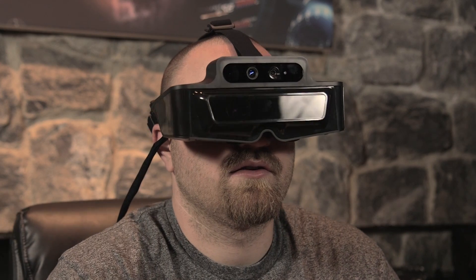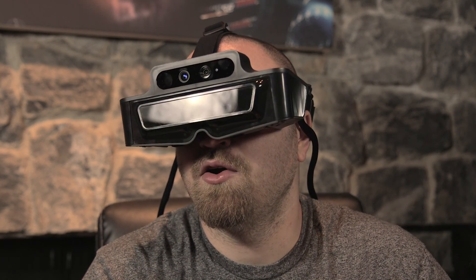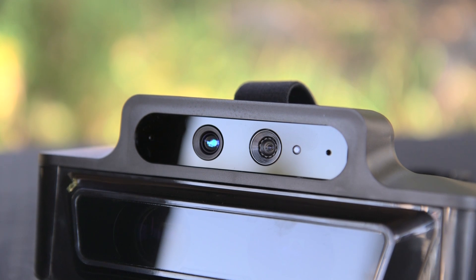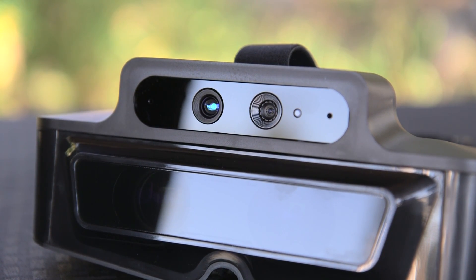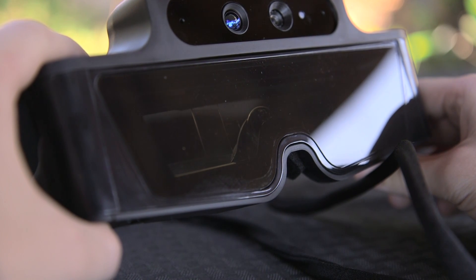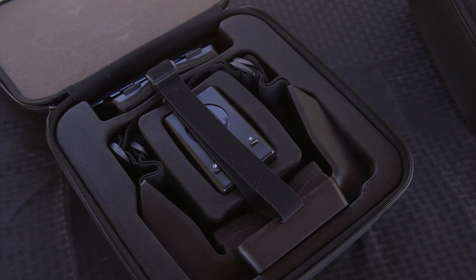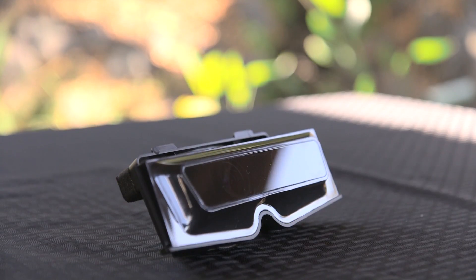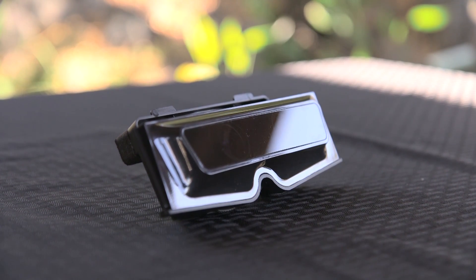The current developer kit is definitely early but it has potential. It's a bit bulky but there's a lot of technology packed in here. Up top are a pair of cameras — a 720p RGB camera alongside an IR camera that tracks depth. The screens are each 960x540, which while not incredibly high resolution, works decently considering you can see through the display. It doesn't entirely take up your vision, but there are a pair of lenses included to give you either a normal field of view or to magnify the screen to make everything a bit easier to see.